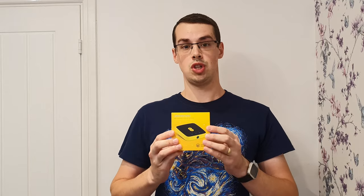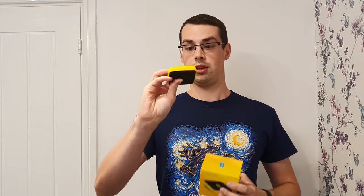The fourth method is to use a 4G or 5G mobile hub, or mobile hotspot. It's a small device with a SIM card that you buy a data plan for, and it acts as a Wi-Fi router, transmitting Wi-Fi in your outbuilding. It's completely standalone and a separate internet connection from your home Wi-Fi. The downside is you have to pay for a separate data plan and buy the device, but 4G and 5G internet is really fast nowadays, so this can work really well.